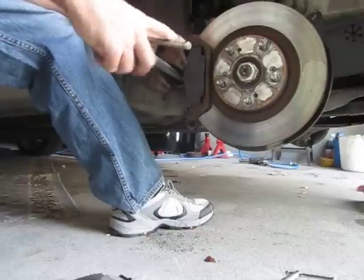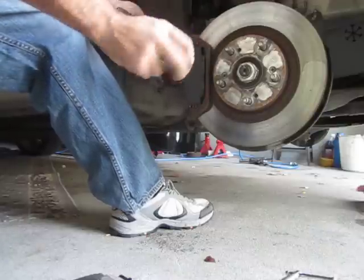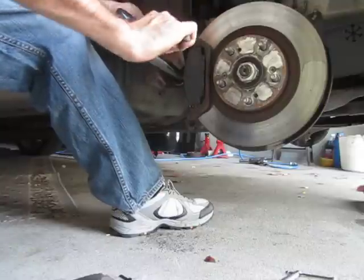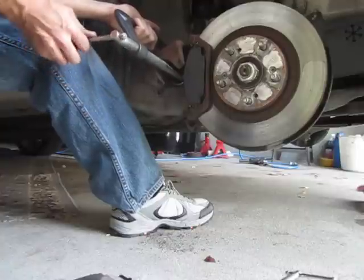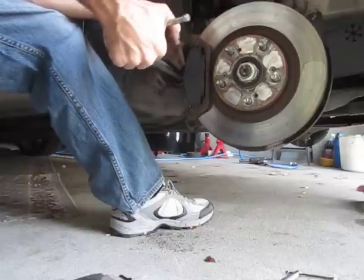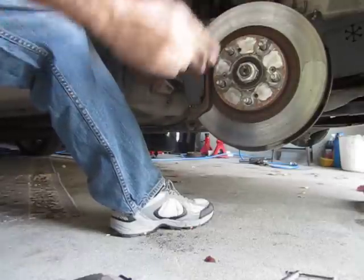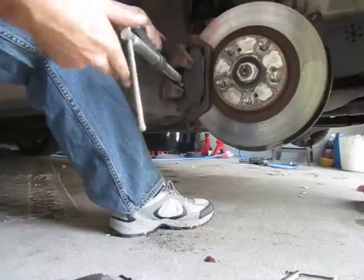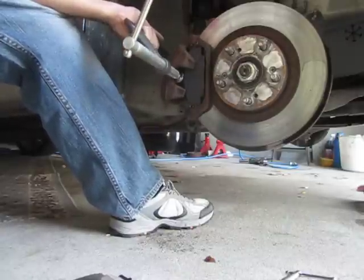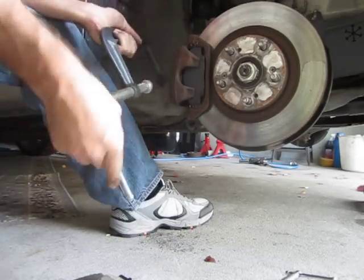The reason I'm replacing the rear caliper is because I was not able to turn it — that means it's frozen. I could tell the car was pulling. If I'd stop from like 70 miles an hour, a hard stop, the car would pull to one side. I could tell one side wasn't stopping the way it should, so I had a feeling I'd have to replace the caliper, which also means I'll have to bleed the whole system — or maybe just that one. I like tight brakes, so I'll most likely bleed them all if I can crack the screws. It is an '02 so some of the bolts are rusty, but hopefully I'll get lucky.